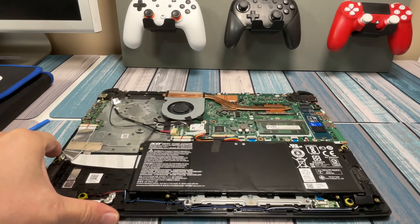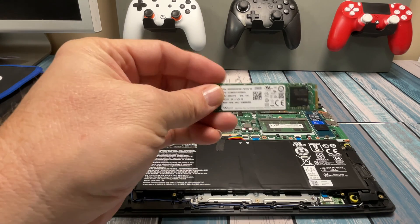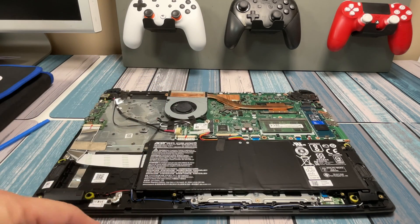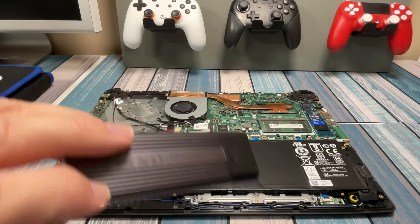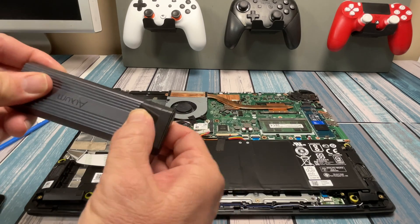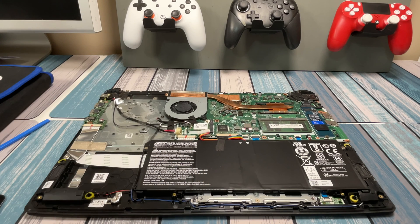Now we got the hardware all done — replaced the RAM, replaced the SSD. Remember all your Windows and files are on the old drive, so if you had anything you needed to save beforehand, that would be a good idea. If you want to grab anything after the upgrade, you can do that by grabbing an NVMe enclosure like this. These are super easy — it's just a USB drive basically. Pop your old drive in there, connect it once you get Windows running, and copy over any files you want. You can also clone it straight onto there. I usually just do a full brand new Windows installation and then copy over any files and programs I need afterwards.